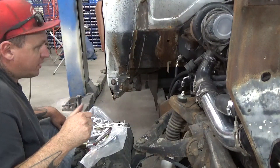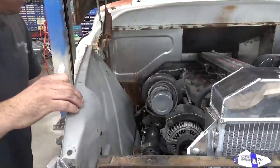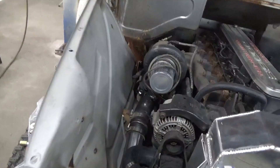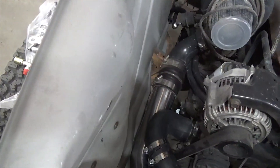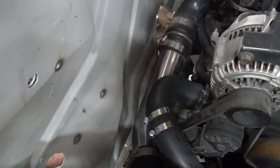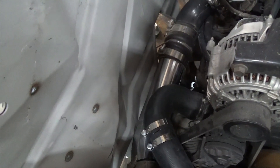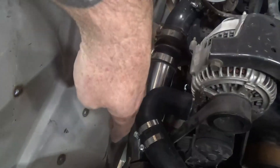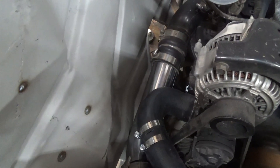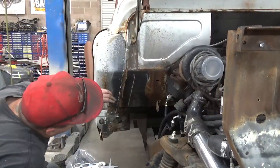I think that's our very bottom one. I'll check on the inside and then get our inner fender well up here to mock up and see where we're at. The bad news is the inner fender well is hitting the turbo tube before it can settle all the way in here on the core support. So our issues with our turbo tube continue. It's just going to have to be modifying the inner fender well — I'm just going to take out that corner there. I'll mark it out while it's on here, maybe not fix the spot but get it cut out to where I can see what I need to do. You probably can't see the line that I penciled out but you're just going to have to trust me on it.